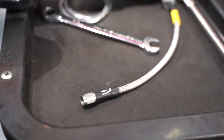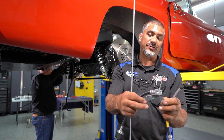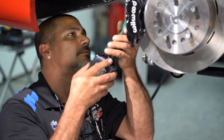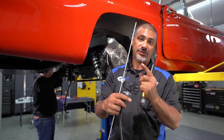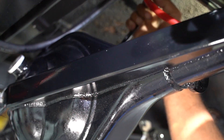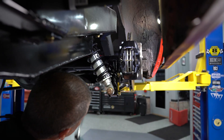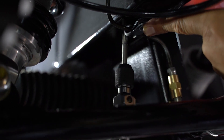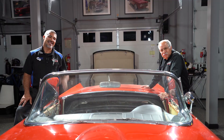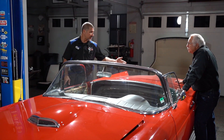The brake line is going to come off the caliper with a dash-3 fitting. We've got this union that's going to bolt up to the Ford 9-inch — two top holes. This allows the rear end to move up and down, so this is going to be welded onto the car. Then we'll run two brake lines from the union to each caliper, and run a brake line from the union hose all the way back to the master cylinder. We should be done in roughly 17 hours.